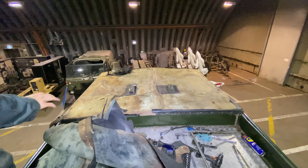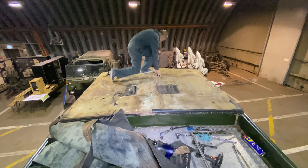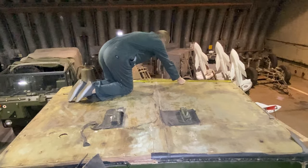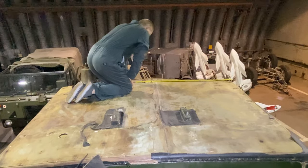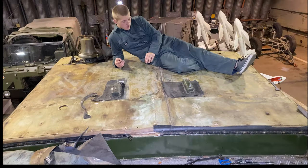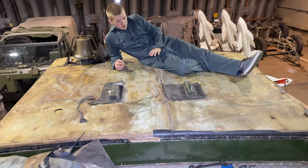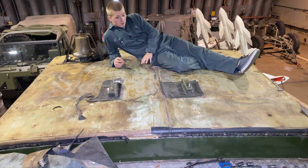The last thing I'm going to do - I apologise for the camera wobble as I'm walking on the roof - is measure the panels. The wooden panels are not straight. They're not square - they arch. So I'm going to measure for excess and then I'll know exactly what I need. On this roof there's a mixture of nails and screws - they're all completely rusted to the point where they've literally turned into dust. So they'll all need to be drilled out. As I'm replacing the whole roof, I can just cut around them with a jigsaw or something like that.